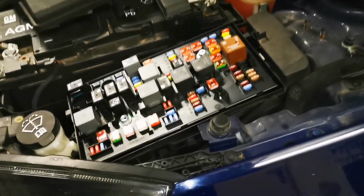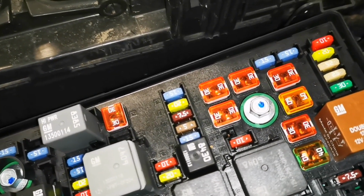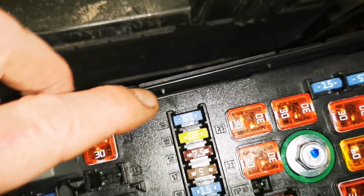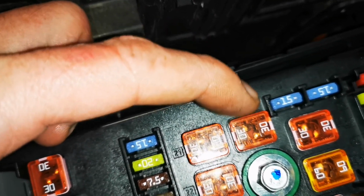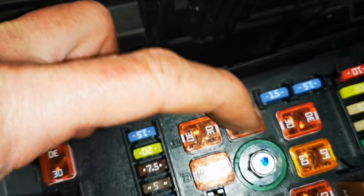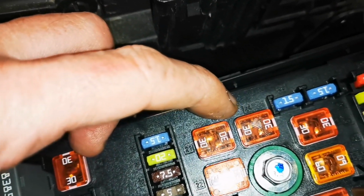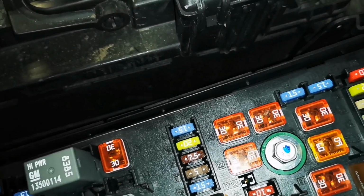You know, I really can't help thinking that the police has disabled these rear windows deliberately, and there's actually nothing wrong here. So these are the two fuses here. That one there, I think 24, well, it's 21 and 24 anyway, for front and rear. I think that one is the front, and that one there's the rear. So check these two fuses, pull that one out, and yes indeed that disables the fronts that are working, and I swapped it about, mucked it about, doesn't make any difference.